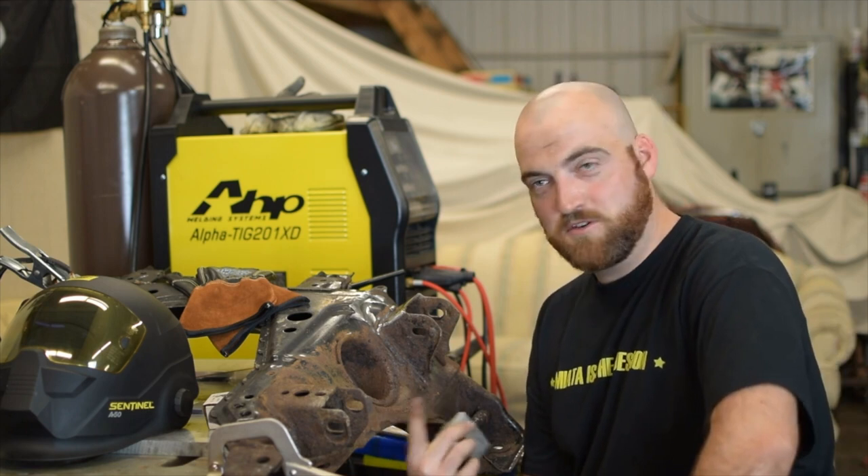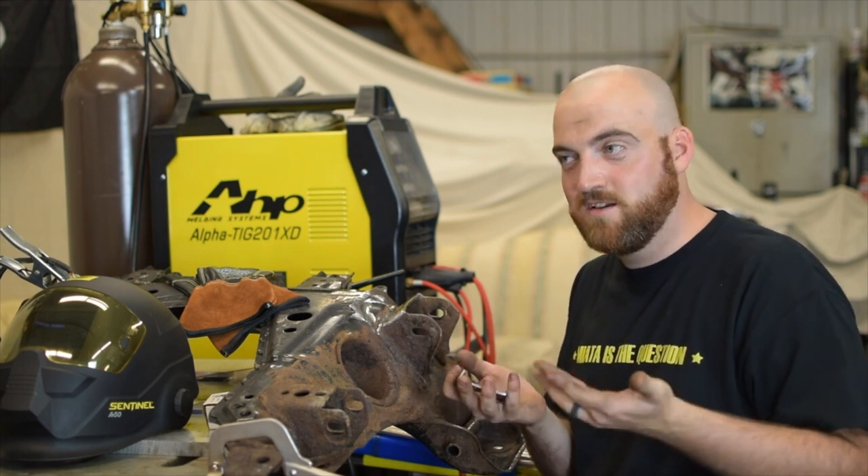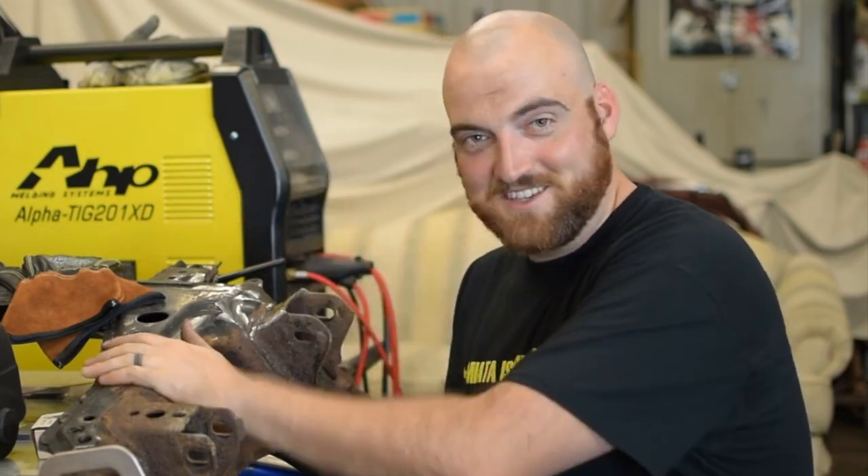The benefit is the steering rack is better. The steering rack angle is higher up on the subframe, so when you go lower, your Ackermann angle is not all screwed up. That's what this is.